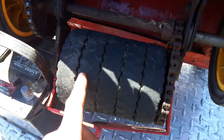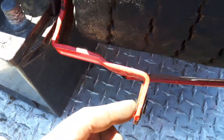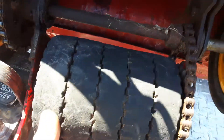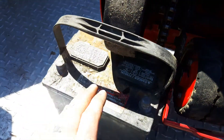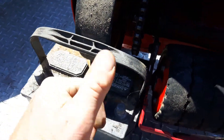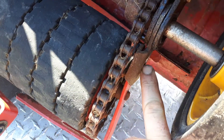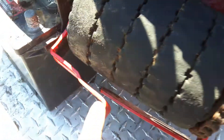What you do is disconnect the drop pivot right there — it comes off the handle. Pull the cotter pin out and remove it so that the wheel bracket drops. I'm using a battery as a jack stand — safety first. You'll undo this half-inch nut, which is the slide adjust for the chain tension.